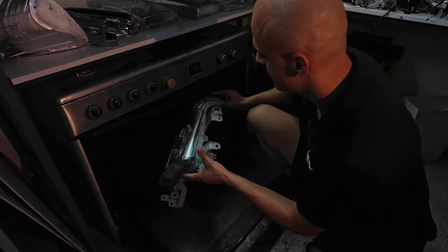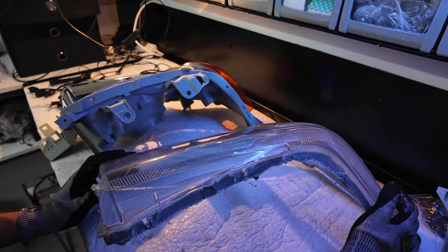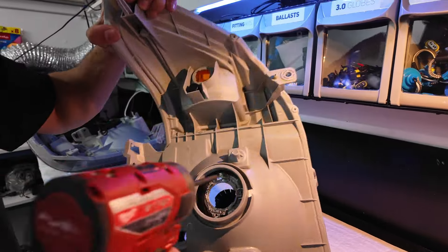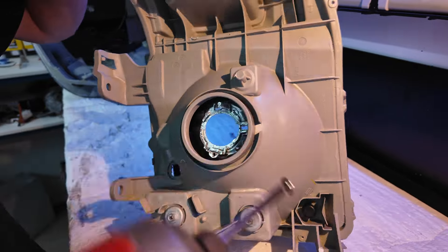You may need some gloves to carefully pry the lens apart as it will be hot. Once it's split, set the lens aside and keep it upside down to prevent any dust from getting in. Any globe deflectors can be removed, and the headlight is ready to build or paint depending on what look you're going for.